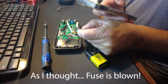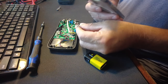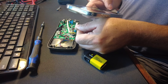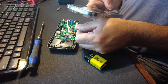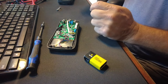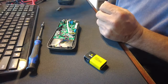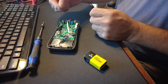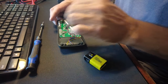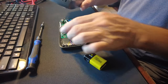These things are almost impossible to read. I got more pictures of things that I can't read. Yeah, this is only a four amp fuse — that's only a four amp fuse, this must have been replaced. A lot of this stuff was my dad's stuff, so I couldn't find a 10 amp fuse. I'm just going to put a 15 in it. These meters are so cheap, if I burn it up I'll throw it away.